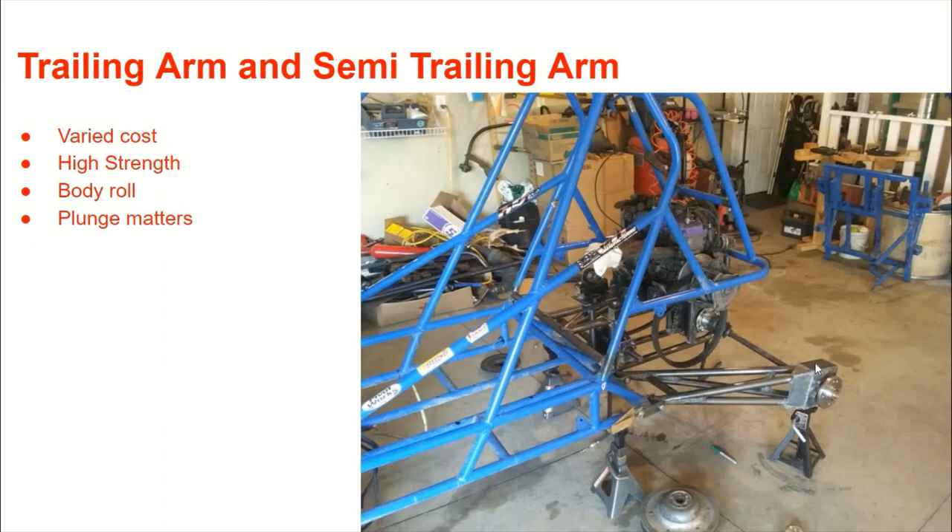When the wheel bearing is in line with the axle, that's actually your shortest distance. So when your arm moves up, the distance from this point to here is actually longer than the distance from here to here at rest — that's one thing you're going to have to pay attention to. If you are going to use a trailing arm or a semi-trailing arm setup, the only difference between the two is that a semi-trailing arm, instead of having these two points in line with the axle, they'll be at an angle. So you will get camber change throughout the travel so your wheel stays flat on the ground. But that's one thing we had trouble with — you really have to pay attention to how much plunge you have.